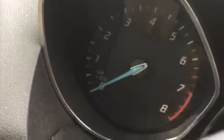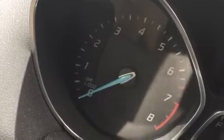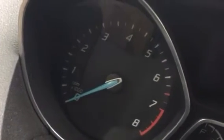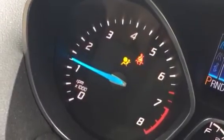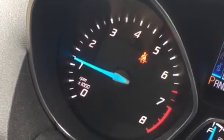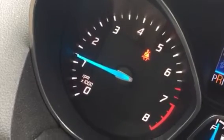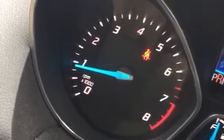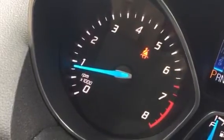Here's the problem I'm having with my 2014 Escape four-wheel drive with a two-liter engine. I start the car cold — first thing, it's at about 1,250 RPM. I drop it into reverse, it goes in very smoothly and drops down to maybe 900 RPM. If I go back to park, it stays at that RPM.